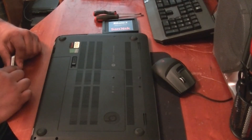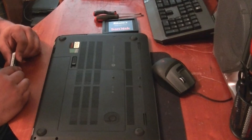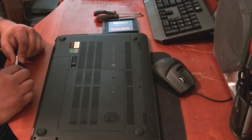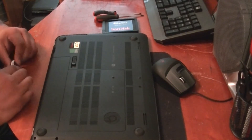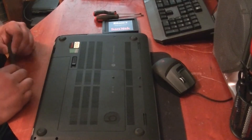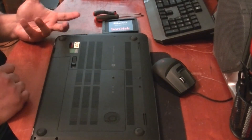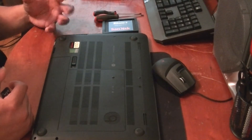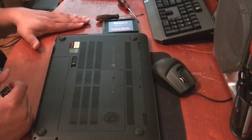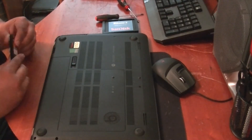If you are upgrading to anything that is smaller than the original drive that HP put in your machine, it will not work — and when I say will not work, I mean it is not going to work. Most SSDs are going to be smaller than your normal hard drive. Anytime you try to use HP recovery media to put any SSD in that's smaller than the drive it shipped with, it cannot work. You'll get all the way to the end of the recovery process and get a message that says 'recovery failed,' even though there's nothing wrong with the hard drive. There's something built into this software that does not allow it to recover to anything smaller than the original.